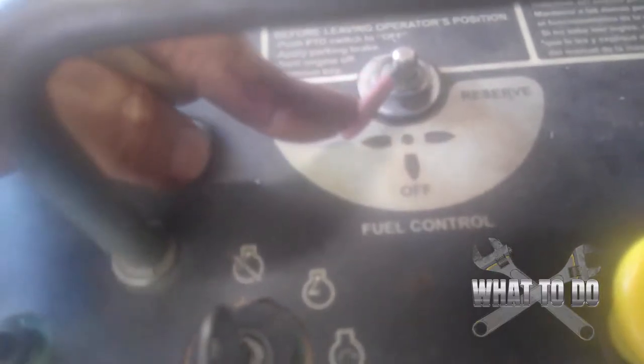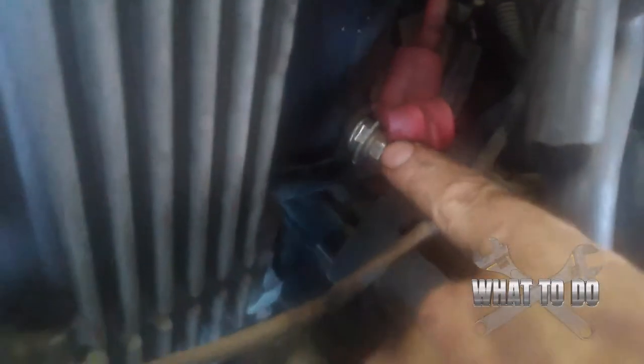Come up top and shut your fuel off — the fuel pump's back here. We got a hose coming to our fuel filter here, so we're going to pull that hose off of there. There's no gas drip in there, so we're okay. I'm going to safely secure that in an upright position back there for now. Here is your power wire to your starter — we're going to take that off. Starter wire is off.